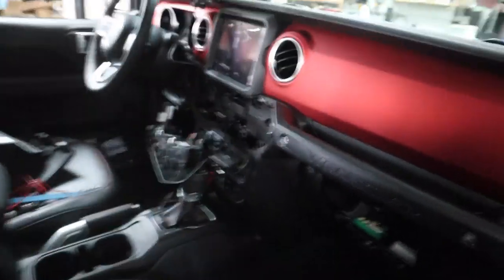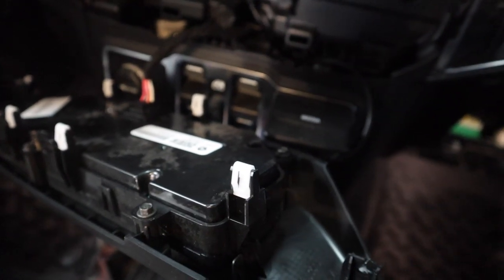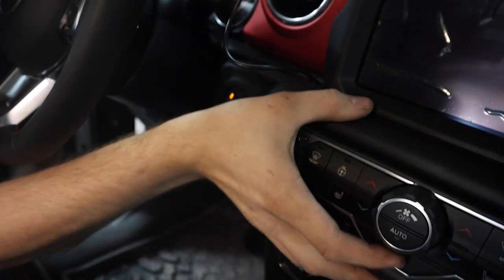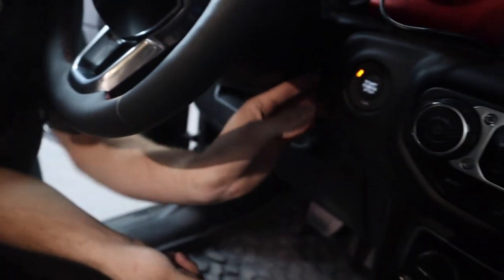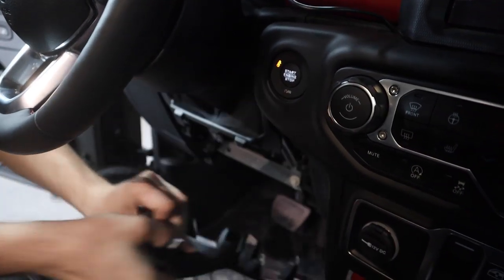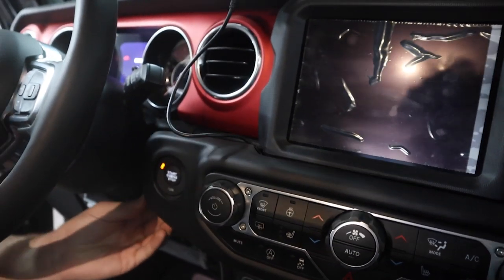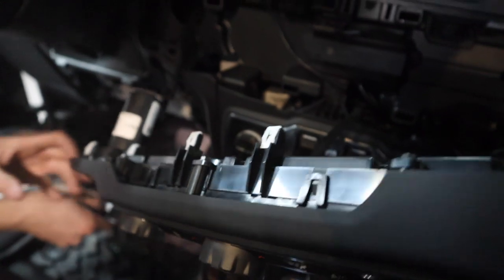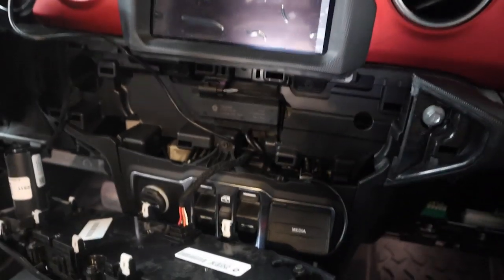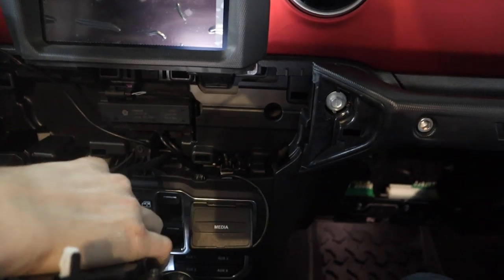Up here I already got this center dash taken apart. Basically it's just held in by push clips. You're going to get a trim tool, or Tracy had a good suggestion of just going up underneath and prying from this side. You grab it from the corner up here, grab it from the corner over here, and this completely pulls out of the way — then this is now open. You just pull it here and work your way along, and the whole thing comes out. It's actually a much better method than using a trim tool and prying on one side — with the trim tool you can get marks on there that you don't want.